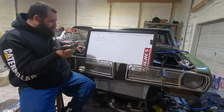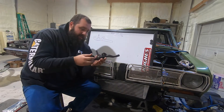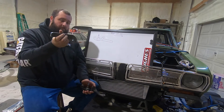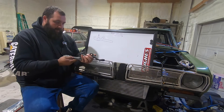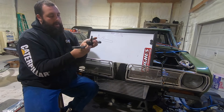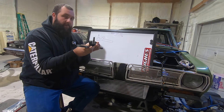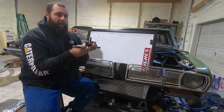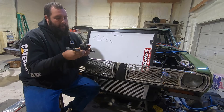What I plan to do is the same as what I just showed you — I'm going to hack the back off because I don't need it. I had some tabs cut. This is 5/8-inch steel arm. It's going to go on to here, which I'll have to fit. By moving the mounting hole for your steering linkage outside of the ball joint, it doesn't completely fix it, but it makes your Ackermann and your bump steer better. Your bump steer is controlled by the length and the angle of your steering as opposed to what your suspension is.